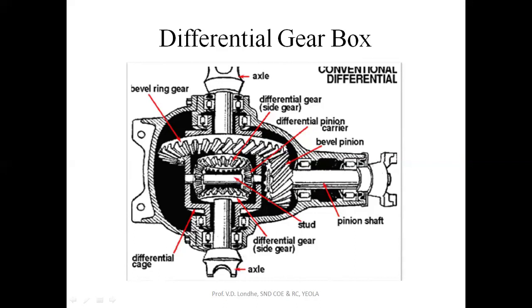So when your vehicle is moving on a straight path, whatever the speed going to both the wheels, it should be equal. With the help of this differential gearbox, the speed will be equal when your vehicle is moving on a straight path. But when your vehicle takes a turn to the left side or to the right side, in order to avoid skidding or to avoid the vehicle losing contact with the track, there should be some speed variation,